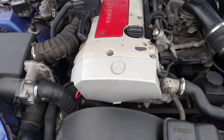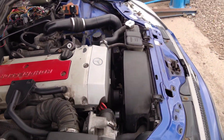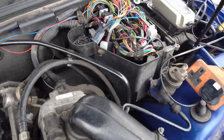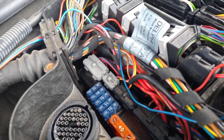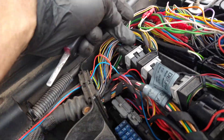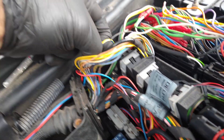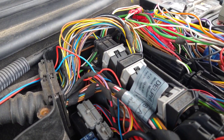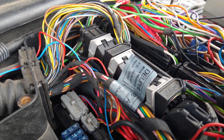Now that's getting power. So it gets power from over here and all these wires — power from this relay. It's getting powered okay, but it gets its ground from over here in the engine, that wire right there. So it's getting its ground from there, meaning it's the engine ECU telling it to be on all the time. Just got to figure out why.